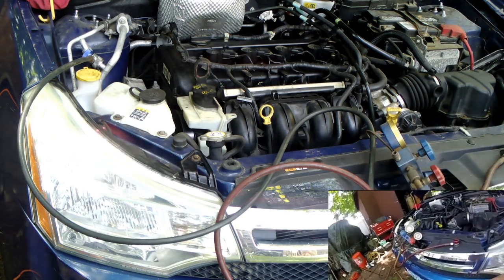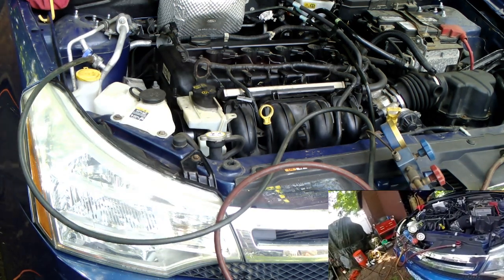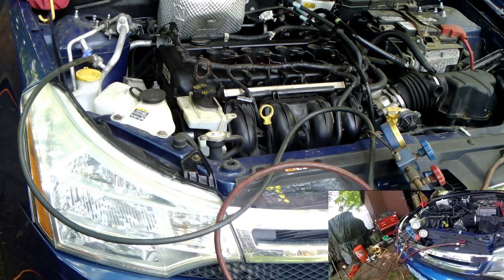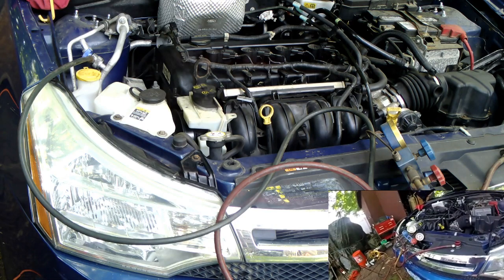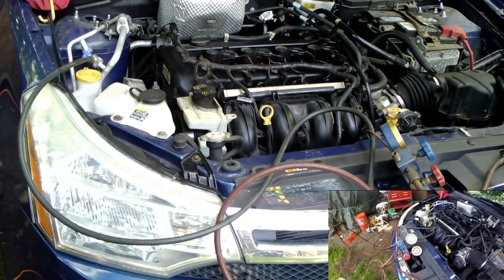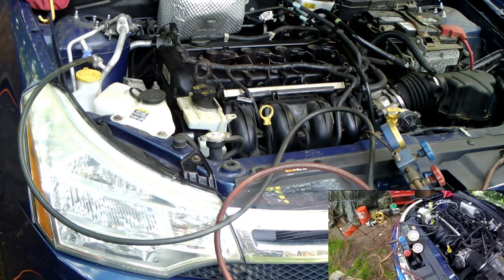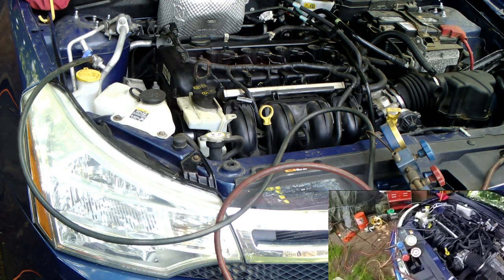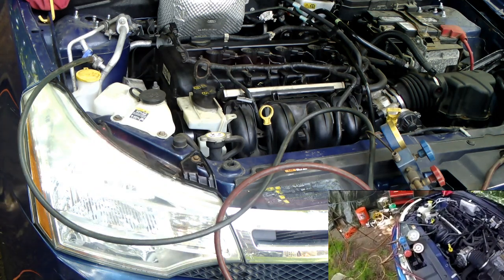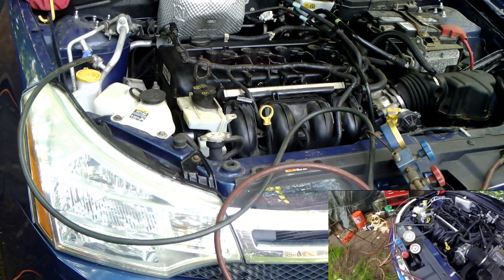We only charged her up through the high side. Guess I never opened that bag up. Guess that was all on the lines. Still 15 there. Yeah, so we're still at 23-ish. Little side gauge. It looks like it's cycling on and off right now. Yeah, it's cycling. It's kind of odd for this type of day, but okay. I'm going to go ahead and drive it for a couple days like this, see what happens. I'm not sure why it's cycling. Usually, might just because it's a cool day out.